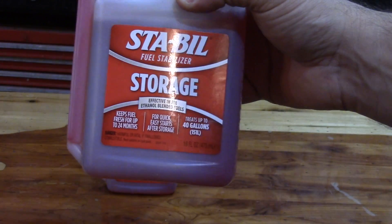This happens to be a 16-ounce bottle. A couple of tips for storage: the first thing you want to do is clean any debris off your small engine equipment. For instance, if you have wet grass underneath or on top of the deck of your lawn mower, that moisture will cause your paint to disintegrate and begin rusting. Next, take the battery out of your small engine equipment — there's no reason to store it in a cold shed. Bring it inside, trickle charge it, and take care of it that way.